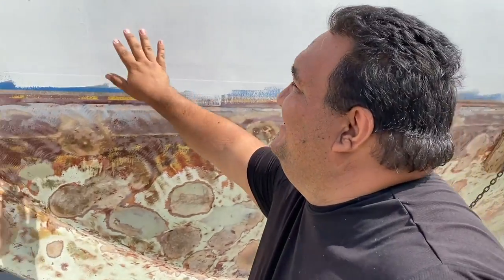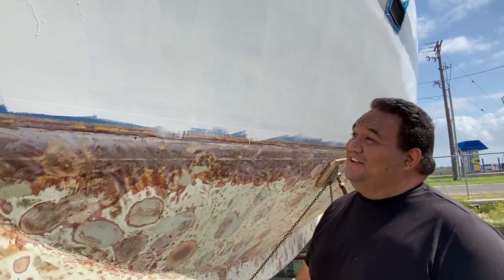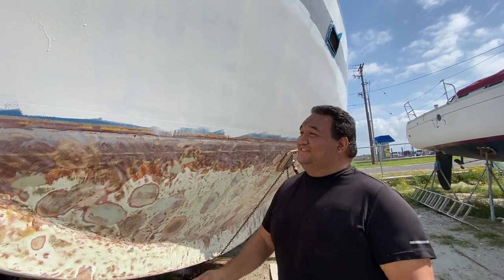Slightly misread the directions. Actually, we did everything like we thought we were supposed to. Watched videos on rolling and tipping, and it didn't quite work out. But we missed one small detail. We got 3/8 nap instead of 1/8 nap, and because of that, it did this. See the runs? So my thing was, I was like, you know what? It looks like rhino liner. You know, it looks like a tough ship. So I was gonna say, let's just go with it.